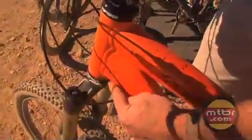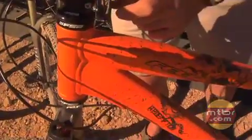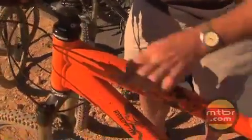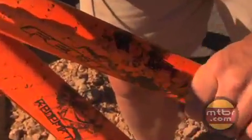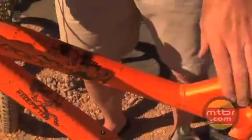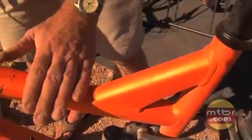You can see the lower tube, the upper tube, the top tube and down tube. There's a big purchase, so we're not smashing the tubes flat trying to get to a small 1.1" tube. The tube's shaped out so it comes down where it's highest stress. It's a big diameter tube. As it gets to a lower stress, we go smaller, snakes down to where it meets the seat tube, gusset it up so you've got good standover clearance, because it is an aggressive trail bike and used in a free ride category sometimes. We don't design it so it's purely free ride.